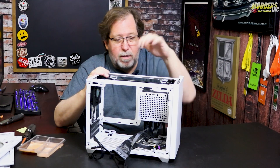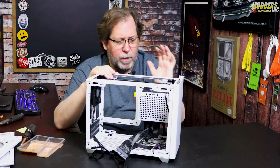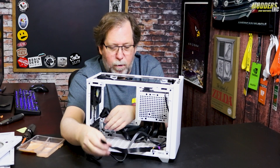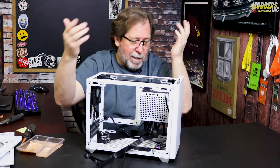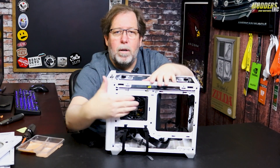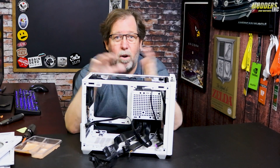There you go — it was just that easy to put into this, and it's just the right size. Of course everything was made for this — Cooler Master — but it's just the idea that the SFX power supply is exactly what you need for this case. I have just all the cables I need: the 24-pin, the SATA for drives, the CPU cable for the motherboard, and the two 8-pin PCIe for the video card — that's it. Make sure you put your fan in going the right way. This is what it's done, this is what it's good for — 850 watts, done.